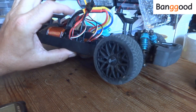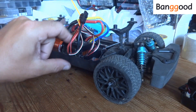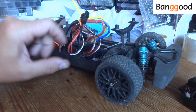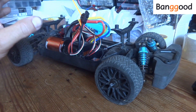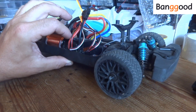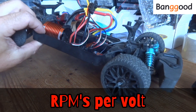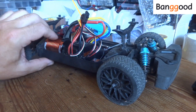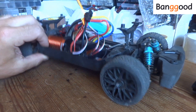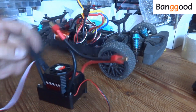I've done a couple of full-speed runs in the street outside using our little 60-amp ESC, and the speed was 24.9 miles an hour — I'm going to call that 25. That's only a mile an hour quicker than our 45-amp Surpass Hobby unit. I did notice with this generic ESC you get a little bit of cogging, where there is none whatsoever with the Surpass Hobby unit. That isn't much of a gain, so I'm wondering if two things aren't happening here: either this ESC doesn't actually pump out the 60 amps it says it does, or am I just reaching the volts-per-RPM limit of our 3,300 kV motor? So it wouldn't matter how many amps I pumped into this thing — it would only ever go 24 to 25 miles an hour, because that is its 2S voltage-per-RPM limit. Anyway, we're about to find out, because I'm going to try and shoehorn this 150-amp unit in somewhere.